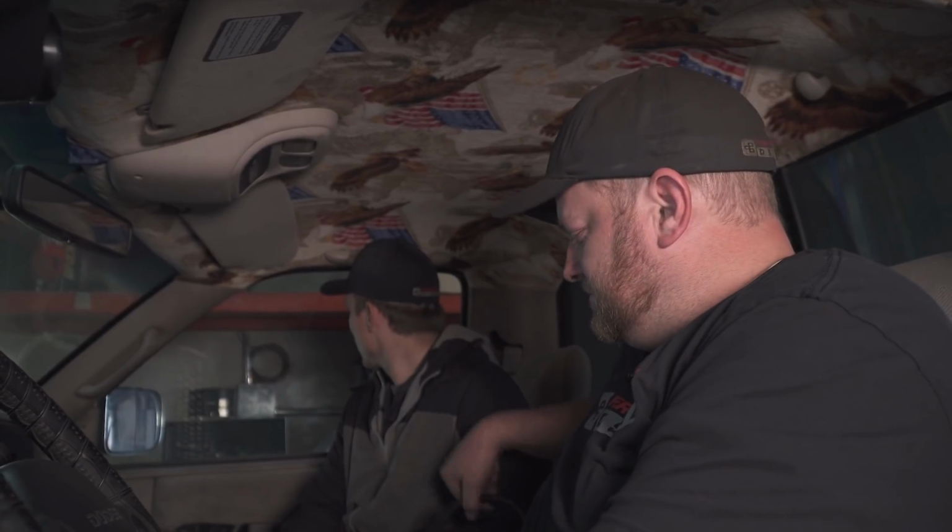Okay. Looks like boost was 27 pounds, 28 pounds. We are ready to roll. One more tow tune, and then we'll do max power. The goal is to get to 500 horse, and we're not going to do it until we put a boost elbow on the turbo. But if past history is any indication of future performance, boost elbows and stock turbos equals blown turbo blowers, as evidenced by the turbos we've blown up on this truck.